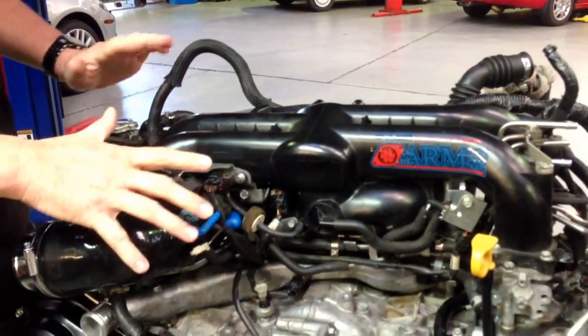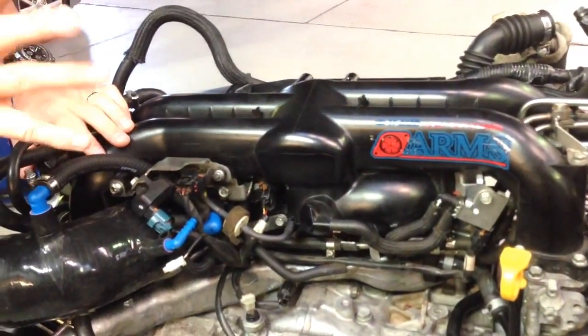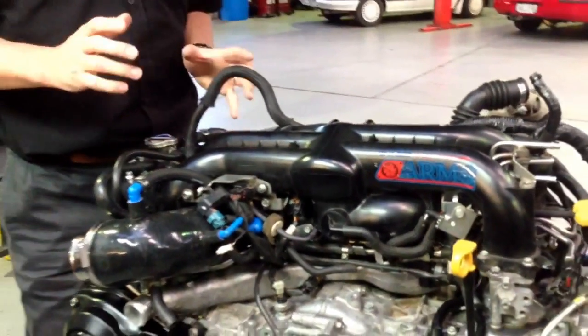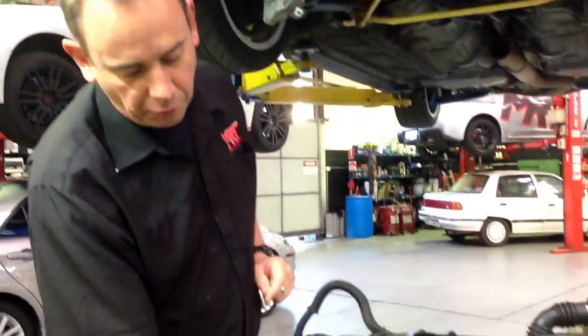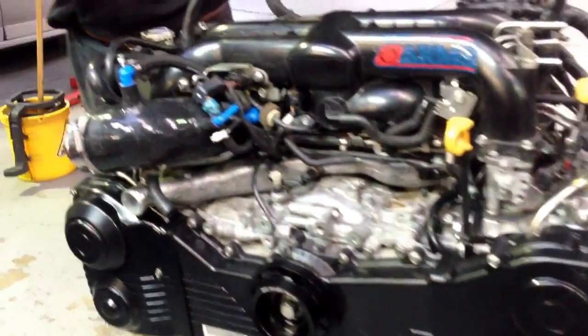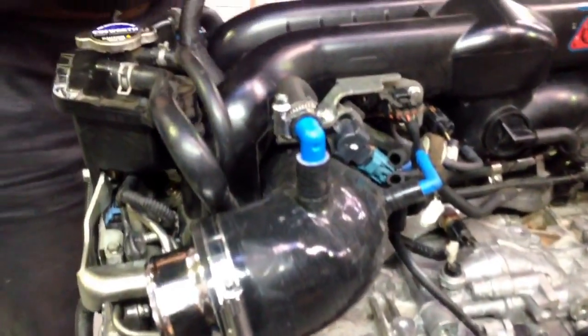This particular engine is a complete built engine which has just been freshened up for the customer. It's done about 50,000 kilometres, probably 40,000 kilometres of that at the track. Some of the things include forged pistons, heavy duty rods, big valve, big port head, and some external things you can see here — alloy crankshaft pulley which fits with the GFB pulley kit. Most notably around the side and the back you'll see we've got the silicon intake pipe that goes under the inlet manifold and around into the Tomei Turbo.